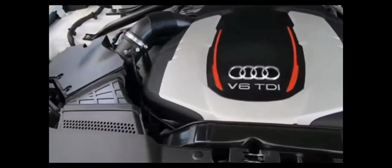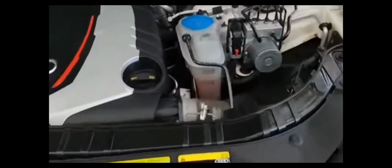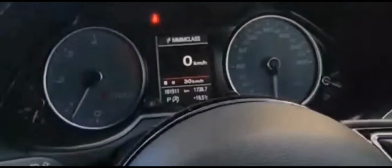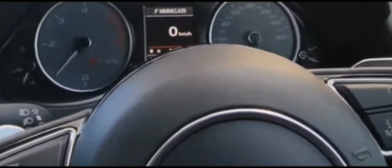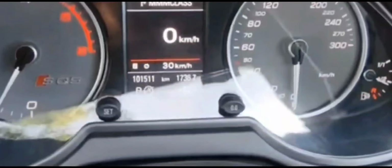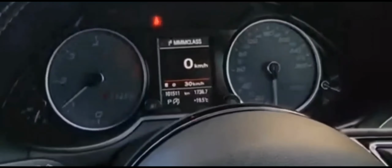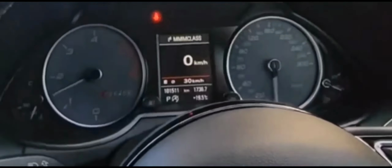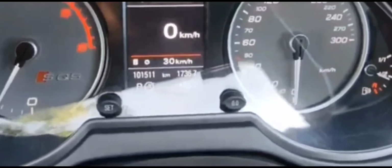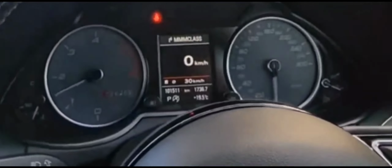And you can analyze the fault codes the ECM throws with an OBD2 scanner. You can get that for $19 at Walmart. These codes will guide you towards the root of the problem, and you can begin replacing parts to try to fix the issue. Upon installation of new parts, you want to continue to reset your computer so that the engine control can learn the new parts and store this new data.